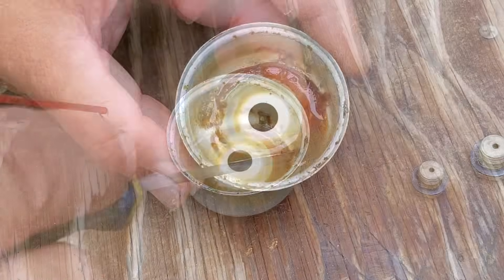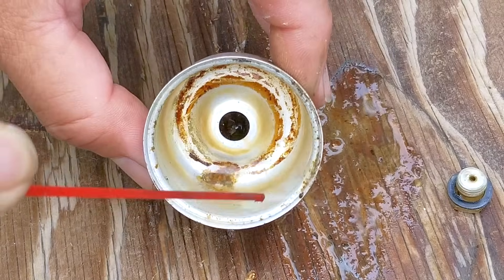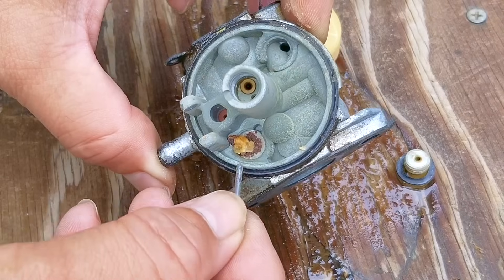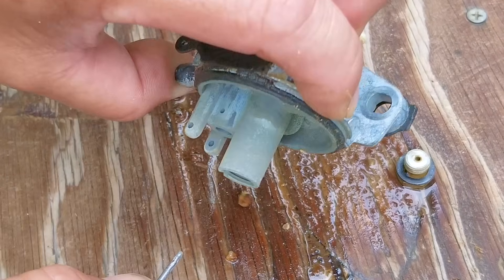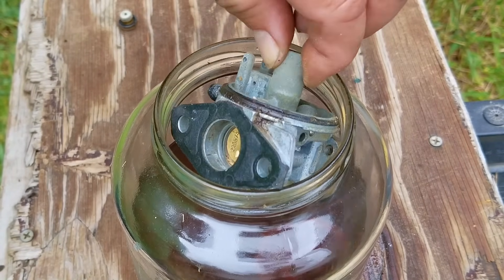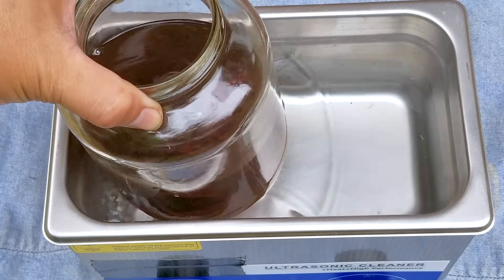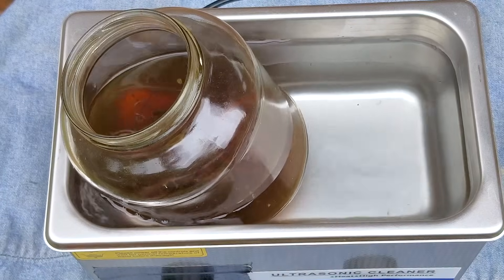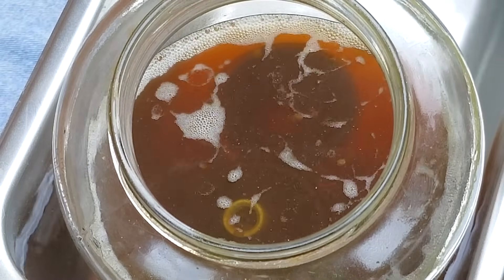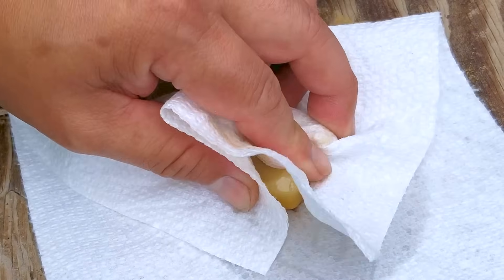Here's the problem with using an ultrasonic cleaner: we have to clean any heavily soiled parts before we put them into the cleaner. After getting the majority of the sediments out of the bowl and the rest of the carb, I'll take the carb apart and put the parts into a jar of cleaning solution. I've gotten complaints that I need to put the parts into the basin without a jar, but there's a reason I'm using the jar — the solution is extremely flammable, so I cannot put it directly into the metal basin. Instead, I isolate it in the jar to reduce the chances of an accident. If my cleaning solution was water-soluble, I would just put it into the basin as directed. I didn't put the float into the solution for obvious reasons, so I'll have to clean it by hand, which is going to be a reoccurring theme on this carb.